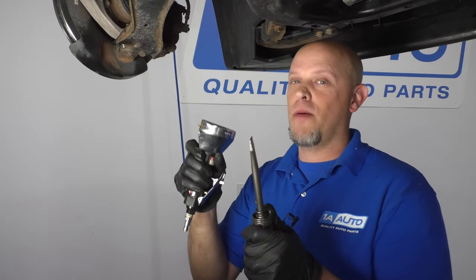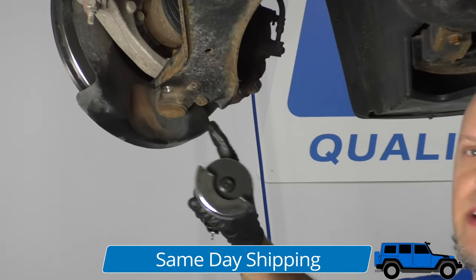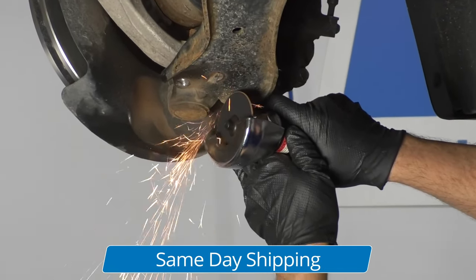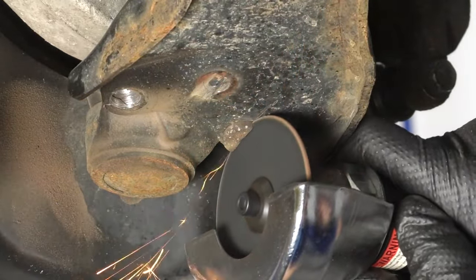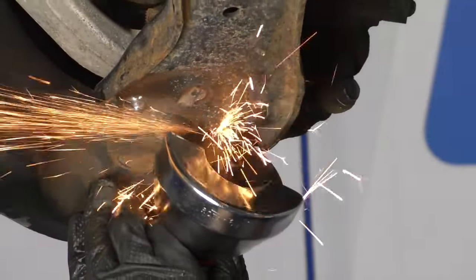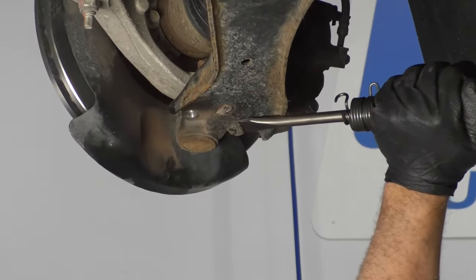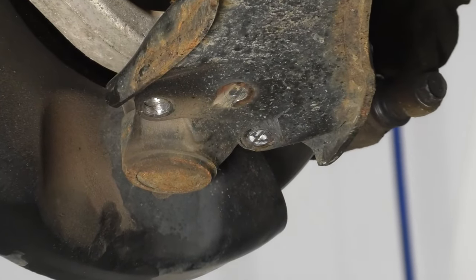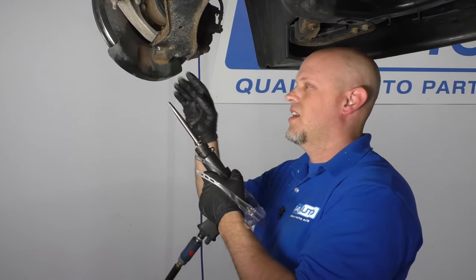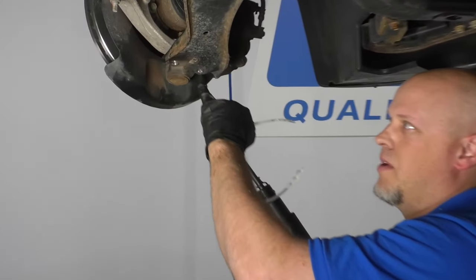For the next method, I'm going to use a combination of an air chisel and the cutoff wheel. I'm going to make an X on the bottom of that rivet, and then I'm going to air chisel it off. Now I'm going to use the air chisel. It was that quick. I could have tried to air chisel it without making the X with the grinder, but it's just guaranteed if I make the X, it comes off real quick. Now I can just take a punch and punch them through.